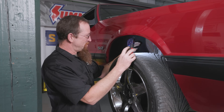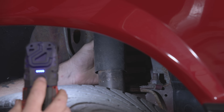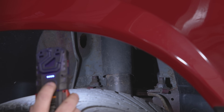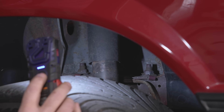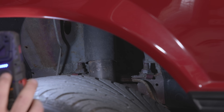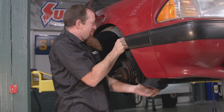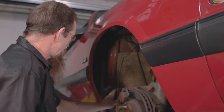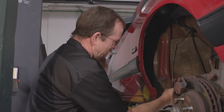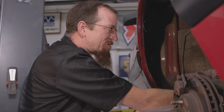Junior was impressed by some initial design elements of the Mustang's engineering. Here's an example of good engineering: the subframe bolts are actually accessible on these Fox bodies. On the IROC they're buried up inside the frame — if the slugs spin up in there, you've got all kinds of problems. On these you can access them; if they're rusty, torch them off, get new clip nuts, and off you go. And that looks really good. I was expecting to find a bunch of rust behind here, but this substructure is actually really nice in here.